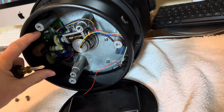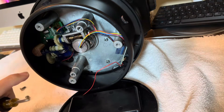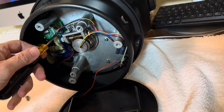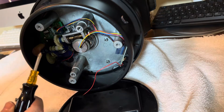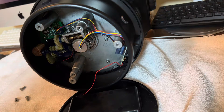You can then lift out the gearbox — it has a circuit board attached to it and the worm gear. Take that out and you want to unplug the wire, this one here that goes over the circuit board. Just unplug that and then you can pull out the whole thing, move a new one in, re-plug in that connector, screw back in the three screws there, and you would have everything replaced.